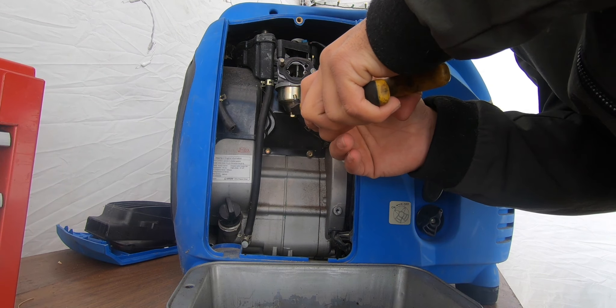Now it's time to crack this open and clean it up. Take that off, then pull this pin right here. This is the float, and within the float is the needle valve. Pull that off. Inside, which you can't see, is one of the jets — the high speed jet. I'll show you how to get that off right now.